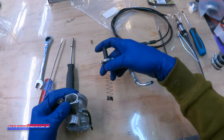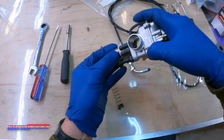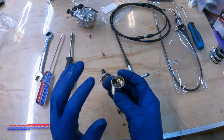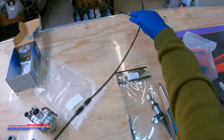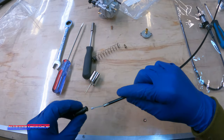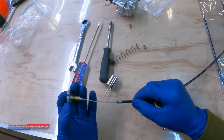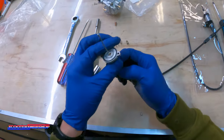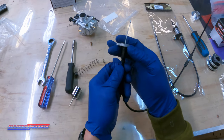So you're going to pull this out. You're going to have your rubber boot here, your slide, and your little plastic retainer. Flip this upside down, pull that slide out — it's at the carb side. Now what you're going to have here is this is your needle with your C-clip. I wouldn't mess with that at this point, just let that drop down like so. You're going to take this guy here — the throttle cable — take this little rubber boot off the cap, slide this rubber boot up the carb. You're going to take the cap cable, thread it through here like so. Sometimes it can be a little tricky. Once you have that guy up there, take this boot, slide it down and over like so. That boot is going to keep this cable from coming out.